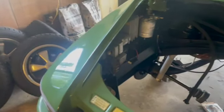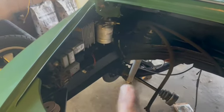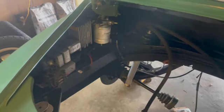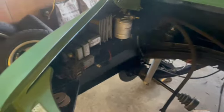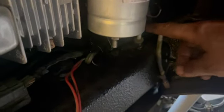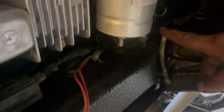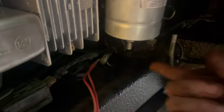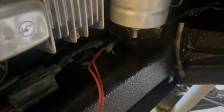All right, so we're going to start running fuel lines. I've been told the fuel line diagram that actually came from Porsche, from their factory workshop manuals, is wrong and you're not supposed to follow it. So on this fuel console, you have two lines coming in from the tank. One is actually return, I correct myself. After it goes to the fuel console, this is directly the filtered main supply that goes to the pump.